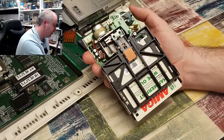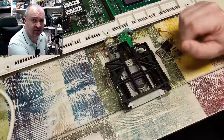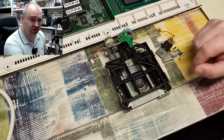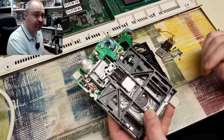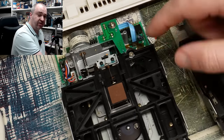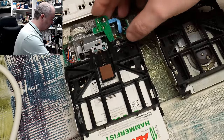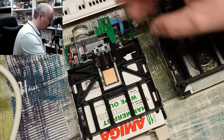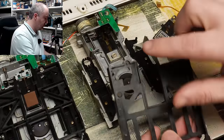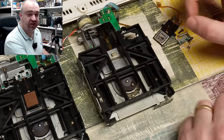That's definitely not right, because the door on the disc is not even being pushed open. I've taken another example out of its cover — you can see there's a little plastic arm just below this top section, and it is that plastic arm which opens the disc door as it's being loaded. On this drive though, the plastic arm is missing — it would sit there, pivoting on that point. That's the reason why the door was not being opened.